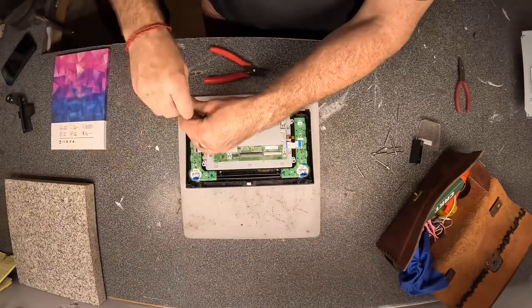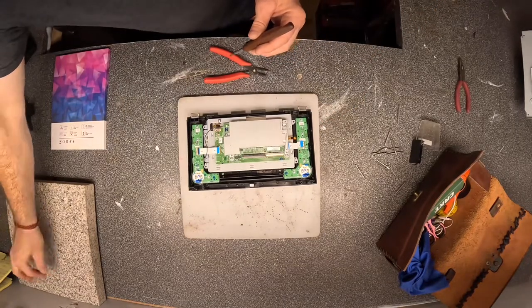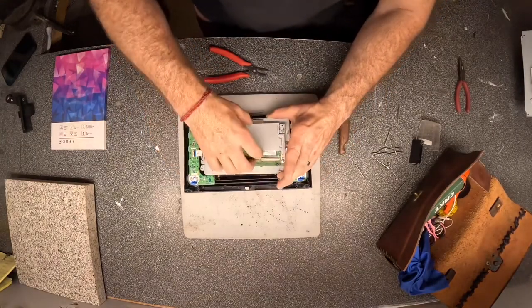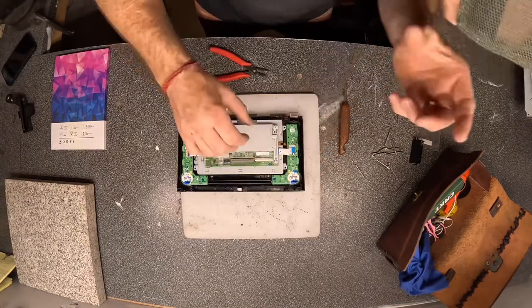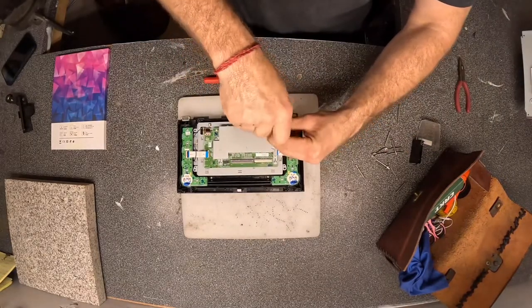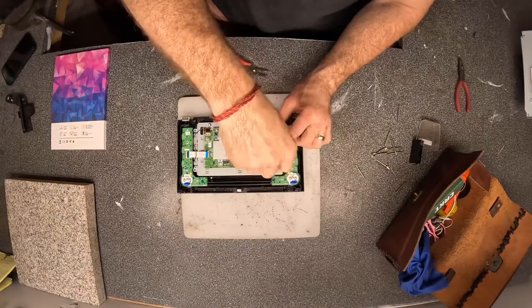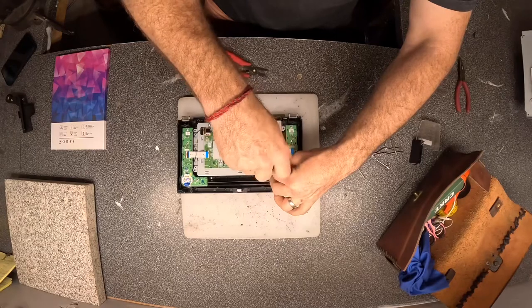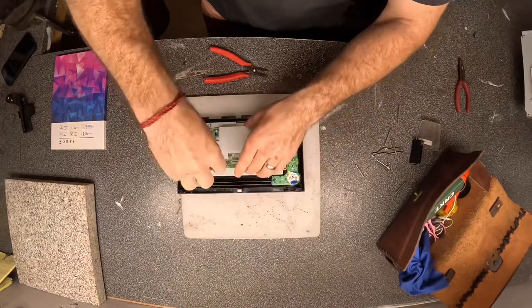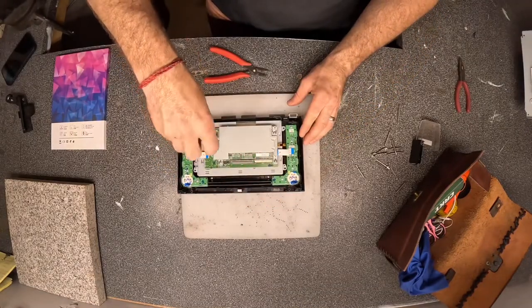So I want to make sure my screws and bolts and everything I pull off is well out of the way. And like on here, I've got it on this marble stone that I use for leather work that I'm not going to bump at all. All right, what did we free up there? So that is the digitizer. So I think I need to pull this so I can get to that cable on the digitizer. So what I'm going to do with this one is leave them in there and leave these screws in the metal shield. So then I can just pull the shield up and everything's in the right place, because I don't want to put anything of the wrong length back into this printed circuit board with the LCD screen under it in case I apply the pressure in the wrong place. Can't say I've never done that before.